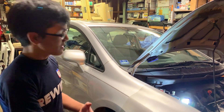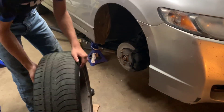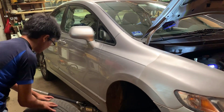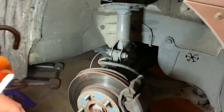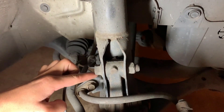I've already covered most of the basics in the other video. Right now we've already jacked the car up, put a jack stand, and taken the tire out. Down here there are two big bolts that we have to take out — they're 19mm, or 17mm, if I recall correctly.